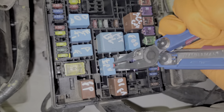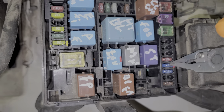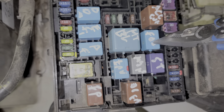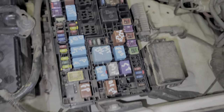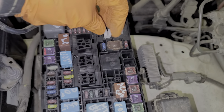The inverter relay is this relay right here. So if your inverter fuse is good, you can try swapping your inverter relay with a different relay, such as the fog light relay. And that's about it for the troubleshooting steps here. There's also a fuse puller that you can use if you don't have any pliers with you.